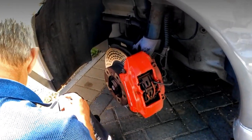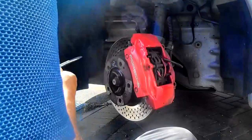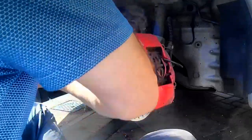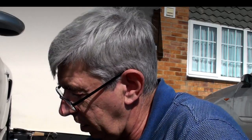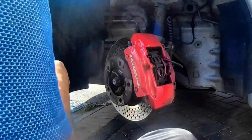Now this one's a little tight, so what I'm going to do is a favourite technique of mine which you've seen me do before — get a bit of WD-40 in there and then work the WD-40 in and clean the threads out. As you can see that is now starting to loosen off. Don't force it too much otherwise you'll bugger up the threads and then you've got problems.